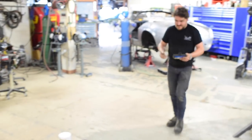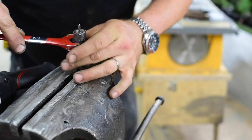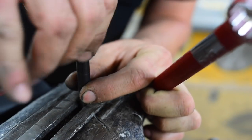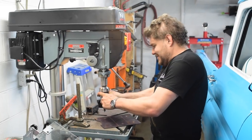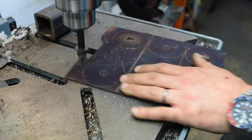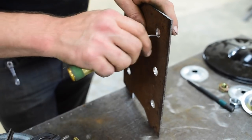What you want when you get the wheel balanced is to have no single point be the heaviest point, and when you spin it and stop it, for it not to creep anywhere, but just to stay exactly where it is because it's more or less perfectly balanced. This process is called static balancing. So once we've determined that our wheel is not in balance and what the heaviest point in the wheel is, we're going to need some balancing weights.